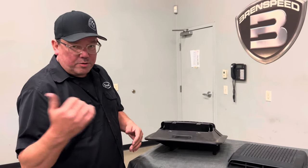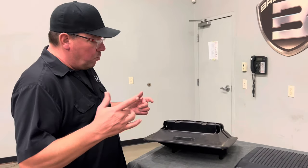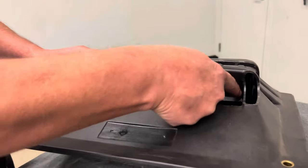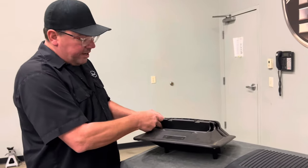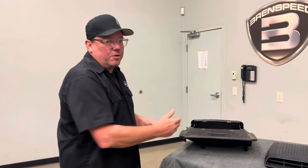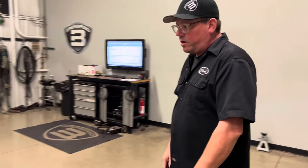Down low it's not a big deal — you still get that nice 490 ft-lb torque, which we achieved because this car has upgraded rods, pistons, and an upgraded crank. What we've done in the past is cut out this rain guard. You could buy spare housings, cut the rain guard out, and now it's wide open air. We had a car one time that was around 650 rear-wheel horsepower — but with the rain guard in there, it was about 90 less rear-wheel horsepower. You wouldn't get much change down low, but where that power curve was going flat earlier, by having that cut out the graph keeps climbing just like any other supercharger. So it's a big deal if you're trying to make a bunch of power. But on a car like this, you still get that low-end torque and it's going to be a fun street car — I love it.